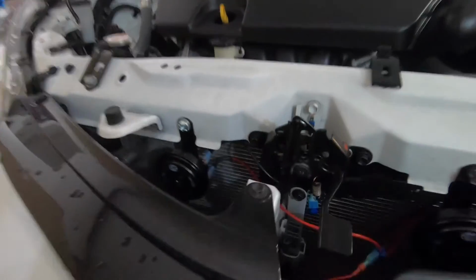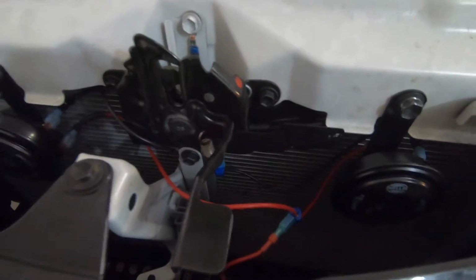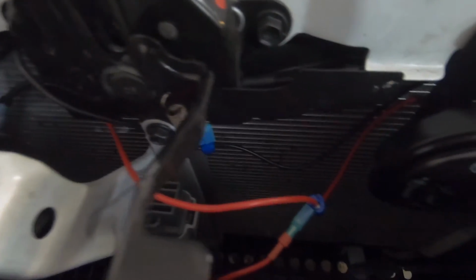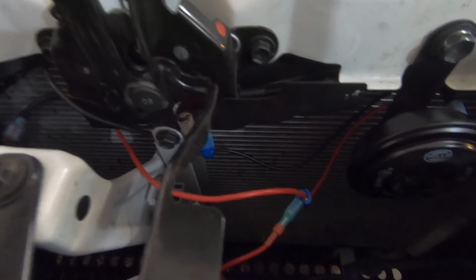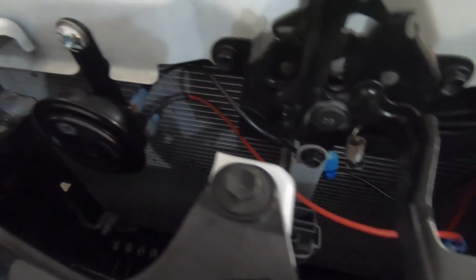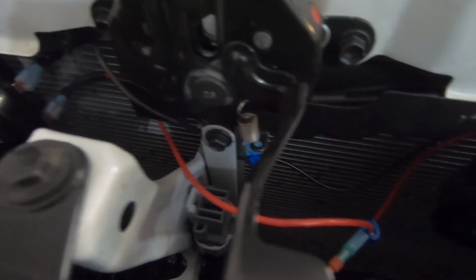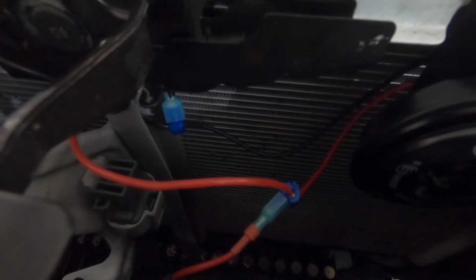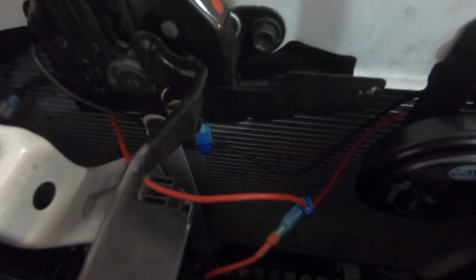So that's the installment of aftermarket horns on my 2018 Toyota Corolla. If you do go about this method, just be aware of the T-taps because they're not always the most reliable and they get a bad rap because of it. But I chose to use T-taps because it was out of convenience and this is the way I did it. Some people may choose soldering, which is more durable or better connection, more reliable, but this is the way I did it. So thanks for watching.